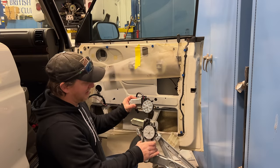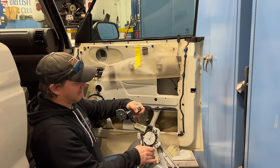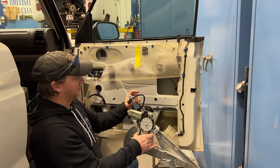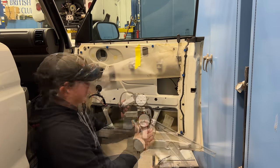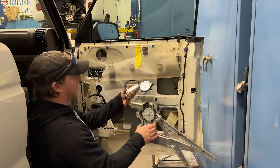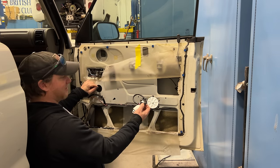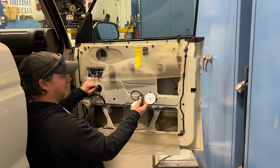I just realized that they have sent me the wrong motor. Looks like this motor will work, but this one has a pigtail on it with a connector that is different than the connector that this original motor had on it. I'm going to go look on the website, see what went wrong here, see if I got the wrong part, or if this is just the way it is now. I need to adapt this to make this work. I checked all of the suppliers and everyone is selling this part as a replacement for this part. So what I'm going to have to do is take the connector off of this motor and also the connector off of this wire and put different connectors on them so that I can connect the two together. This is kind of a pain, but apparently a direct replacement part is no longer made.